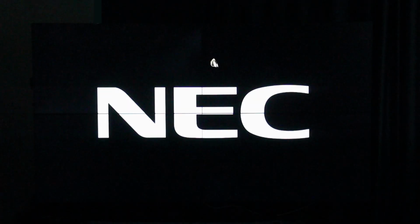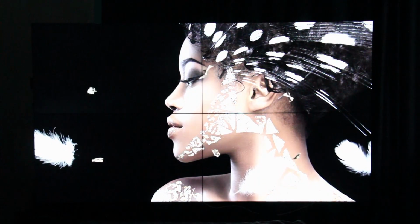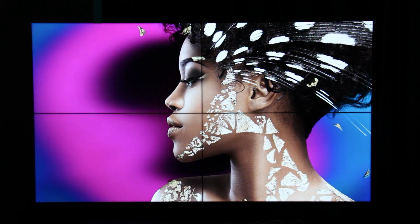After you installed all of the units, gently pull from the unfolded protective stripes, which now should be looking out at the front, ripping off the unnecessary half. After fully daisy chaining the displays with video signals and LAN cables and configuring the video wall, you will enjoy the performance and power of the new NEC video wall platform.